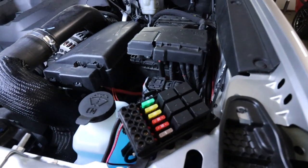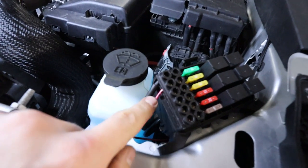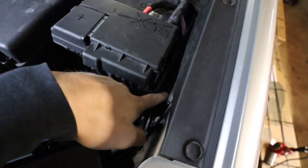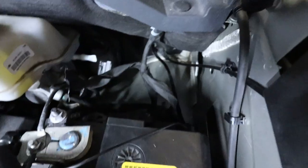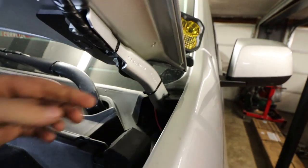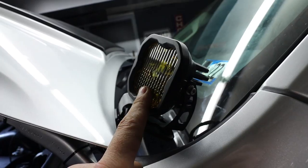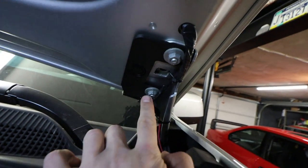Okay, they're finished. Let's go over the wiring — just a quick rundown on how I ran everything. Pretty good for ditch lights. Ditch lights are in an awkward spot and you're always going to see some wiring. Here we have the fuse panel — that's my light bar wire there, and here's the wire for the ditch lights. From there, that wire goes underneath and travels over between the fender and the battery. I actually have it going inside the fender, down in there, and then it pops out back in there. Then it runs up zip-tied to the hood hinge where it splits to each ditch light. Both lights are grounded at that bolt down there.